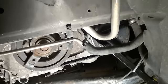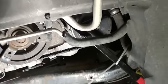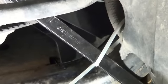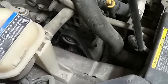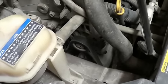I'm working the new serpentine belt on. Another case where it would be nice to have two people, but in this case I just got the tension on there, put a wire tie on it, and was able to do it myself. Go ahead and start it up and make sure everything is working okay before you take the time to put the splash shield back on.